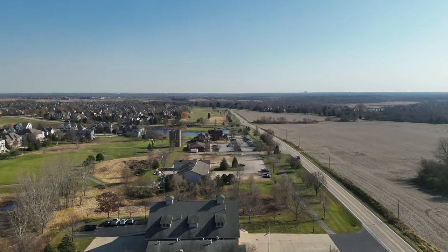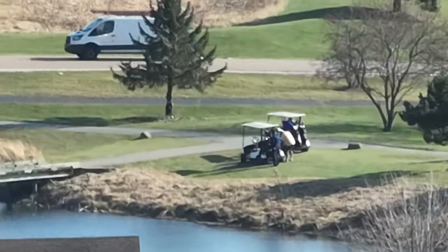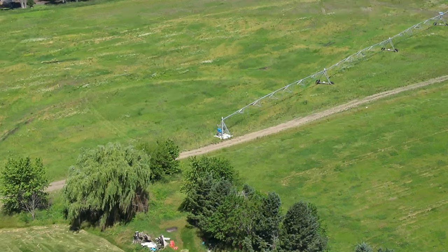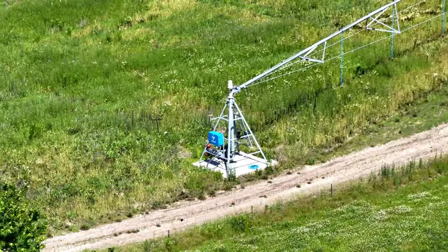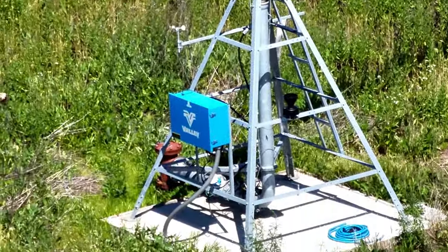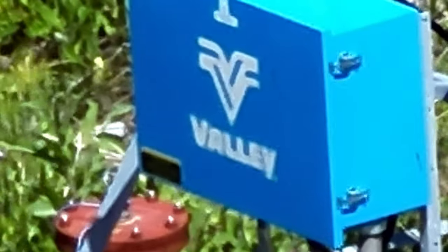Let's talk about zoom capabilities. The Mavic 3T has a 56x hybrid digital zoom — past around 20-30x it will start degrading the image a little bit. The Matrice 30T has a 16x optical zoom and up to 200x digital zoom, giving it almost four times as much zoom range as the Mavic 3T. When using the optical side, you won't get much degradation; it's only further up in the digital zoom where it breaks up a bit. Still pretty remarkable how far both drones can reach.